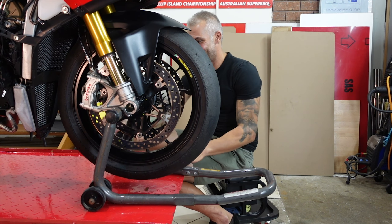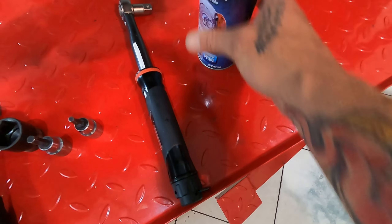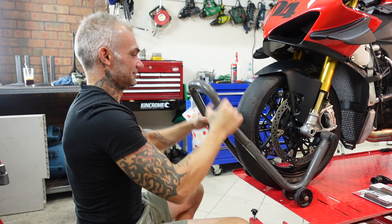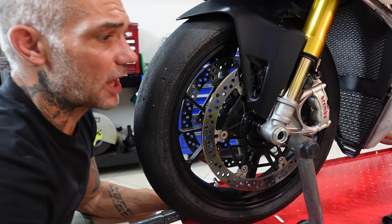What we're going to need: brake pads, a 30mm socket, an 8mm Allen key for our calipers, a 6mm Allen key, a torque wrench, brake cleaner, and most importantly we need a stand.